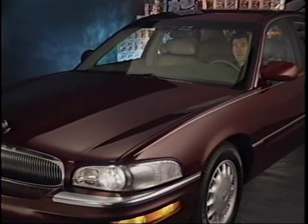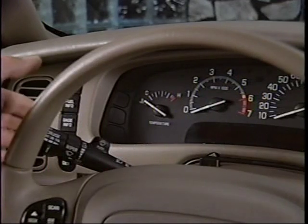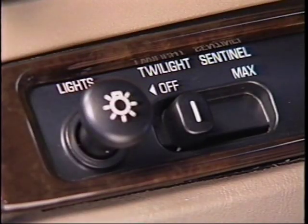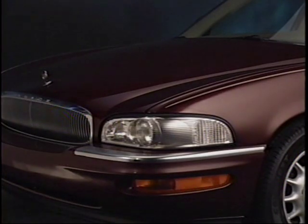The high beam and the flash to pass features are now directly controlled by the lighting control module. The headlamp dimmer switch is only used as an input to the LCM and is no longer used for direct output. Also, the twilight enable switch is now a momentary contact and will only allow the lights to be disabled when the vehicle is in park. If the headlight switch is inadvertently left on after the ignition has been cycled off, the LCM will turn off the exterior lights in 10 minutes.